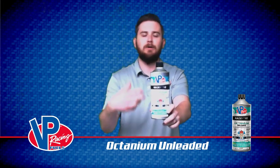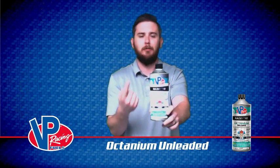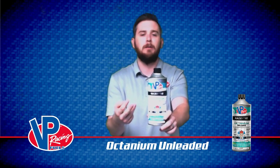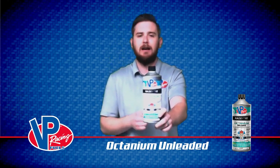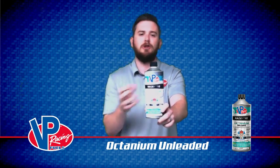That way it's going to act as a good keep clean. As you run this, one, it's going to take care of combustion chamber deposits. It's going to take care of gum and varnishes caused by pump gas, but it's also going to take care of any of that manganese coating when it oxidizes. It's going to clean that up for you.